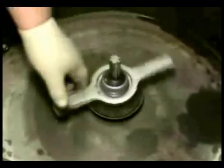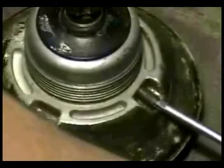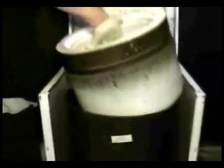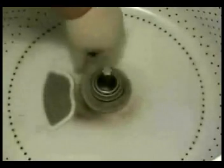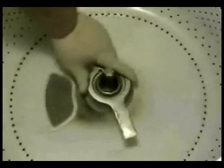Remember to turn the TV123A spanner nut wrench counterclockwise to tighten the stem. Install the stem set screw and make sure that it's tight. Set the spin drum in place. Install the cone and the clamping nut. Remember that you have to turn the TV123A spanner nut wrench counterclockwise to tighten the clamping nut.